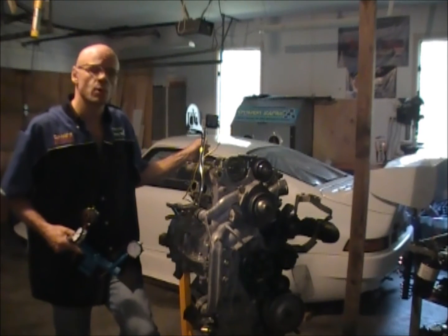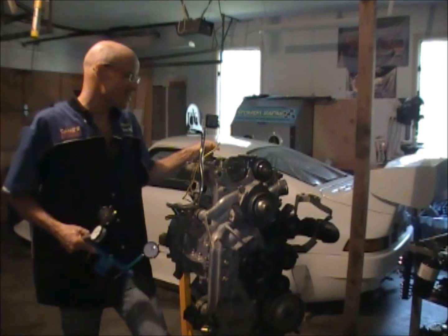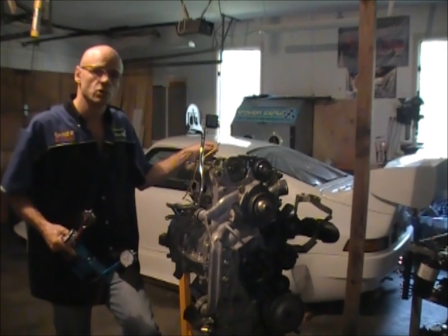It'll give us a reference point and show how the intake cam phases in and out, and it'll give you a reference point as to, in the baseline, how these cams are set up on the street engines and on the GT2 and the turbo engines as well.